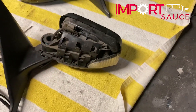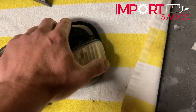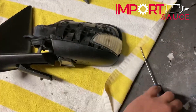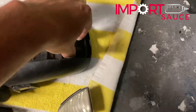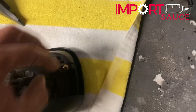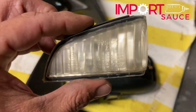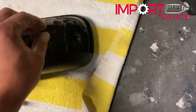If you needed to change your marker light, you do have to take this off. Remove the cap, and then this piece kind of wedges back in between there. The easiest way is to stick a flathead in here and pop that out, and then that thing just slides out. Inside is your turn blinker. We've swapped these out with bright hyper white LEDs, and that thing just slides right into the hole. We've also done a vivid yellow wrap on ours — it kind of brings out the color.